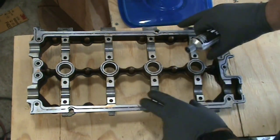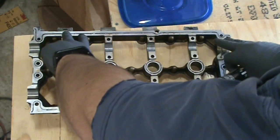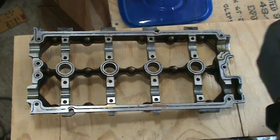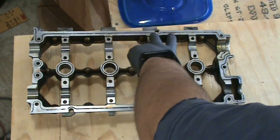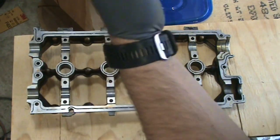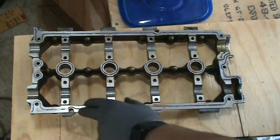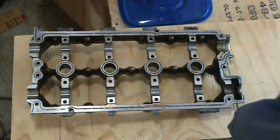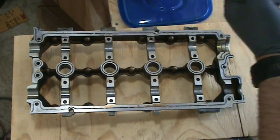So we've squeezed it down with just light pressure on the bolt heads. And then we won't do our final torque until after it's set up. And you want it to get just tight enough to squeeze the material and have contact everywhere and be tightened down evenly. But I feel like doing that final torque just squeezes it out too much. And it will compress a little bit when you put the final torque on it. Or at least that's the way I've done it. And it's been great on everything I've used that technique on so far. I haven't had any leaks.